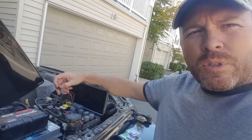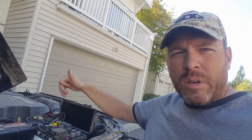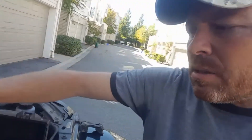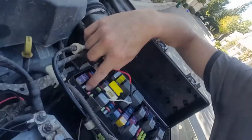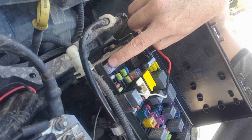This particular circuit that I'm using switches on and off with the accessory position of the key — not ignition, but it goes with accessory, and then obviously when the vehicle's running it's also live. The fuse for that is right back here and you can see it — we've got this fuse, this fuse, and then this spot here.